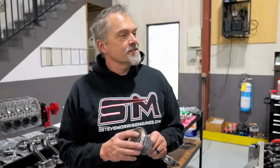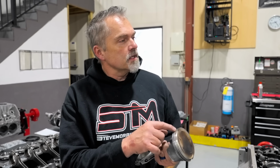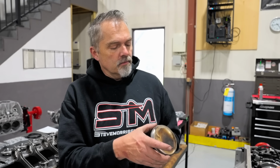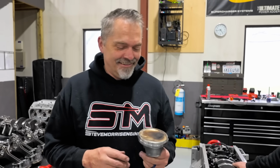This is not a good nitrous setup either. Not the best. Will it take 100 or 200? Yeah, be gentle on it. Does this take a 500 shot? No. Nope. Just break stuff. Usually it'll break the ring lands. The ring would probably be marginally okay. In a 1500 horsepower level total, probably be marginally okay, but it would break the pistons. It'd break something. But you could probably get away with a 200 shot at most. But you're fully understanding that things break all the time. So there you go. All right.